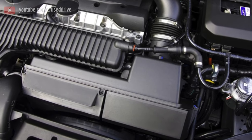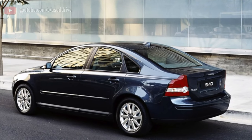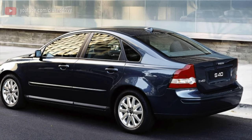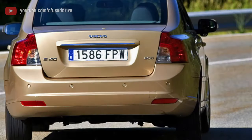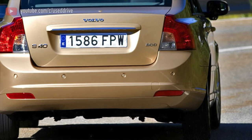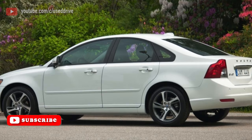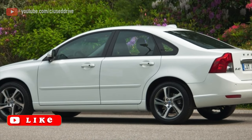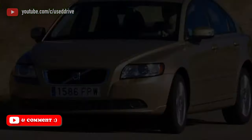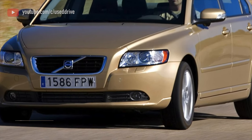What's wrong with M3P-M5P boxes? Actually, everything. The French design can rightfully take the prize for the originality of the manual transmission case. To ensure equal lengths of the axle shafts, the left axle shaft starts directly from the differential. Moreover, inside the gearbox there is a tripod-type hinge. So that oil doesn't leak out, there is an oil seal at the exit, more like a CV joint boot. On the shaft, the bearing is close to the oil seal, and from the outside a casing is put on it, which closes a huge hole in the box. Of course, any damage to the front oil seal leads to a quick oil leak from the manual transmission, but this is only a small part of the problem.